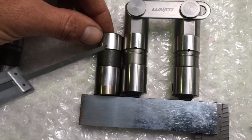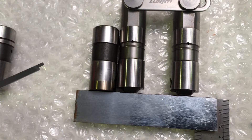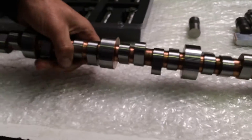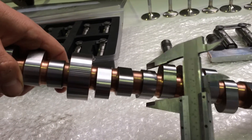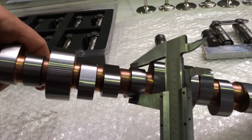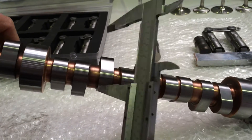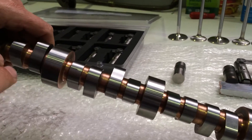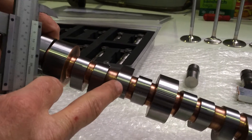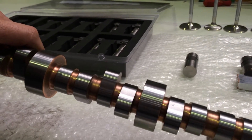Even with the Crane, which is shorter, we still sometimes need to bronze bush and lifter-true the blocks to do this conversion. The other thing that can be done — this is an off-the-shelf Crane hydraulic roller cam — is to put a reduced base circle cam in, which reduces the lobe height. We can keep the same amount of lift, but the lifter starts lower in the bore when it's on the bottom of the lobe, and at full lift it's not coming quite so high out of the block.